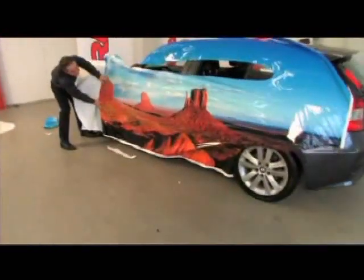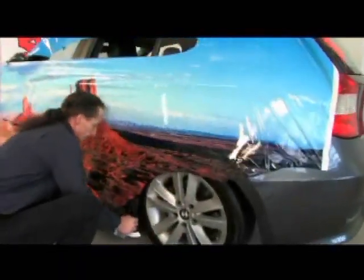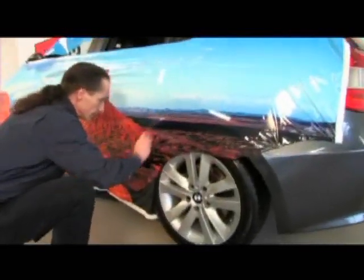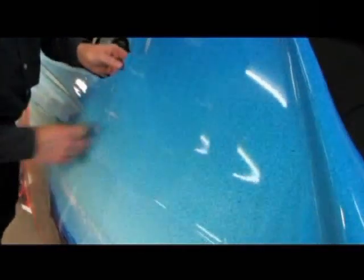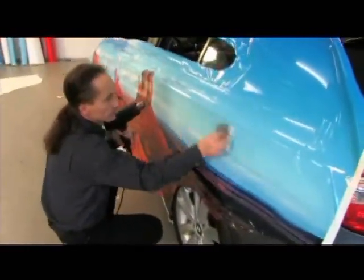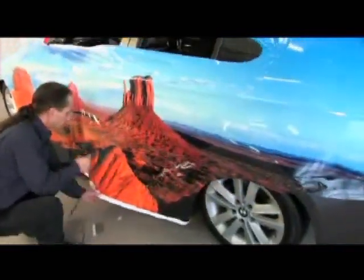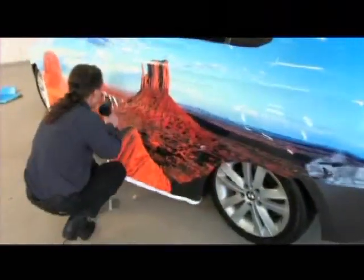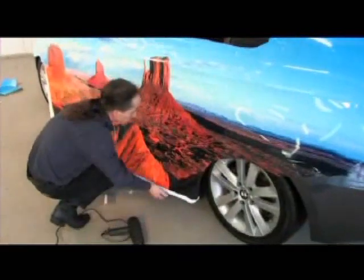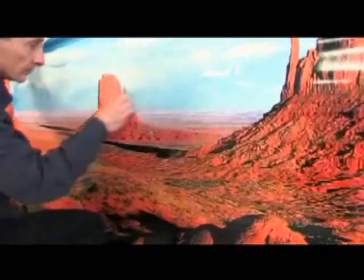The vinyl width is then, carefully and with slight tension, laid across the vehicle, and evenly pressed into place with the squeegee at curved and rounded places. Preheating the vinyl in large sections at 50 to 60 degrees C and generous squeegee movements are necessary to avoid tensions inside the vinyl. The vinyl is pulled downwards to be applied to the vehicle with slight tension, and then smoothed out in even movements with the squeegee, working from the centre outwards.